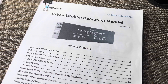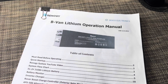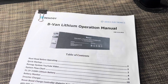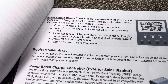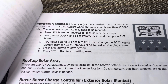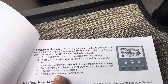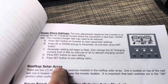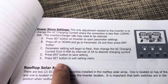Specifically, I was asked to change the inverter setting that will allow you to connect your van to your home if you don't have a 30-amp outlet. If you flip to page 11 of this manual, it'll show you how to change the shore power settings on the inverter so you can bring it down in 5-amp increments. It's set at 40 amps from the factory, but you can bring it down to 15 or 20 amps if you've got just a 15-amp outlet. Here are the written instructions for you.